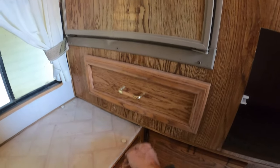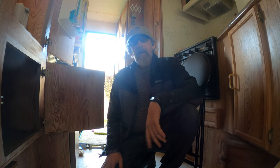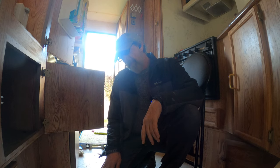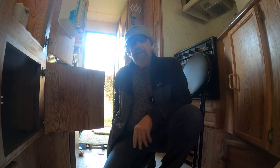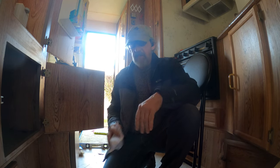We'll come through here underneath this and into the compartment where the water pump and everything is. I already know the water pump supply line is kinked, so we'll be working on that. I'm going to sanitize the fresh water tank — Lord knows how long it's been since it was sanitized. I'll be flushing out all the lines come spring because everything's winterized right now and I don't want to change that.